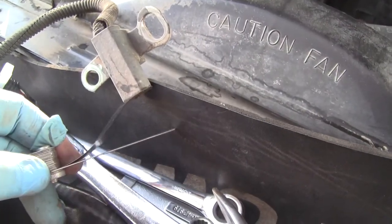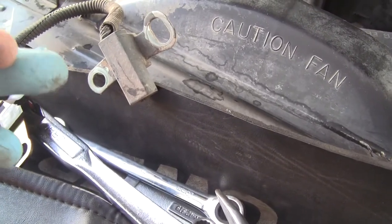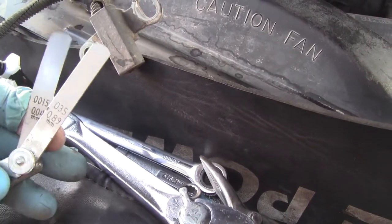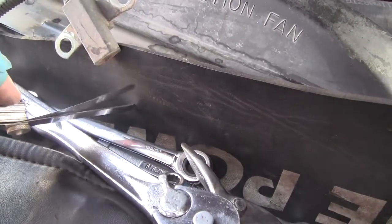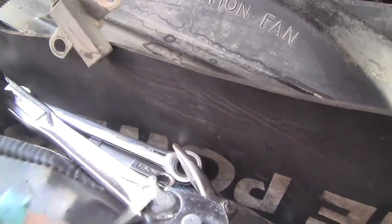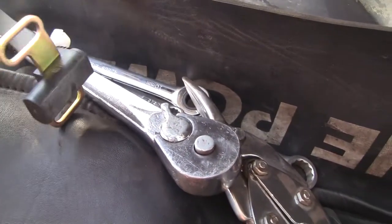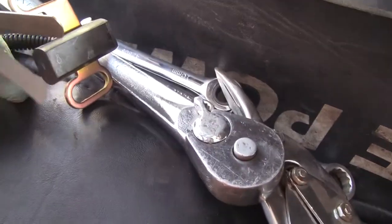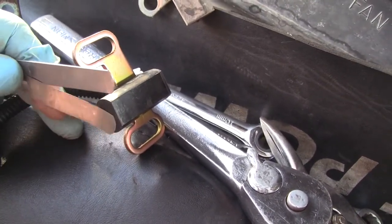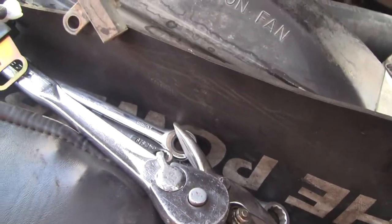With the wind blowing you can see how the sensor barely picks up a thin feeler gauge — about 1.5 thousandths. The sensor is magnetic, and some people say you need a brass feeler gauge. The original barely sticks to a feeler gauge; the new one seems to stick even less. I'm going to use a steel feeler gauge since I can't find my brass set.